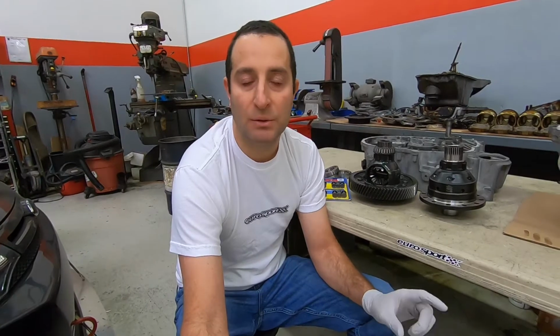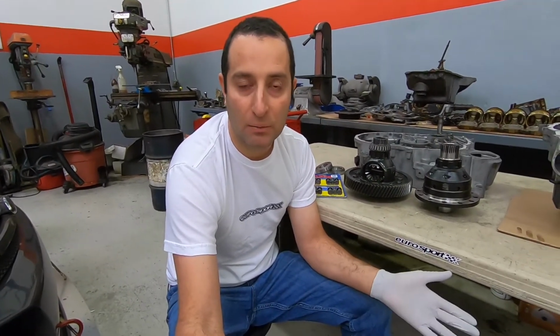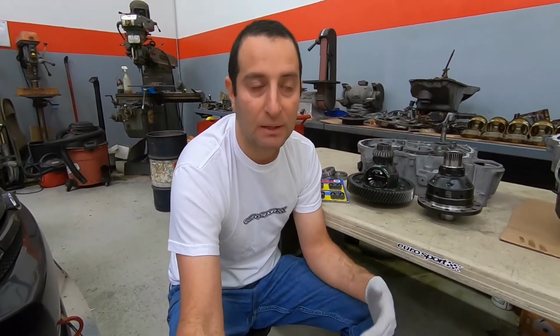In my situation, I'm personally looking to shave those few tenths of a second on all the corners I can, because that adds up to possibly a second or two, like I said earlier. The most important thing with these is being able to apply power earlier out of a turn. So that's what we all struggle to do pretty much in any car. When you're coming out of that turn, you want to be on the power as soon as possible. And I find having an open differential, sometimes it tends to be longer than I want before throttle is applied. So meaning if I do apply it as early as I want, the car will push out. It will understeer naturally, and that's what these cars kind of do. And this will help improve some of that.